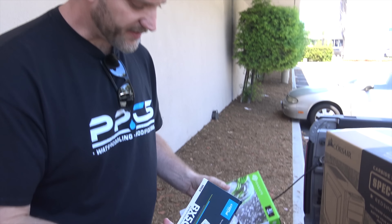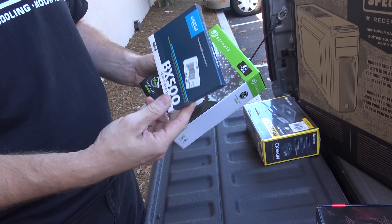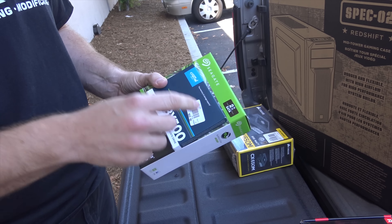In terms of storage, we went with the 2TB Seagate Barracuda 7200 RPM drive coupled with the Crucial BX500 480GB SSD. The 2TB drive was $49 and the 480GB SSD was $49. SSD storage has definitely come down, and 500MB/s read-write is plenty for most people.